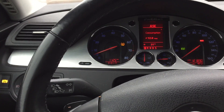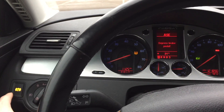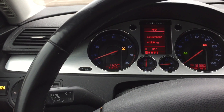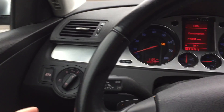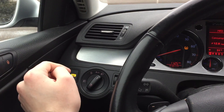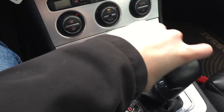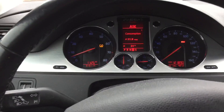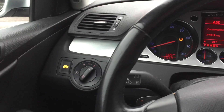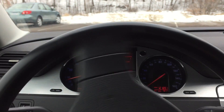The button is to the left of the steering wheel on this Passat — it may be located differently on different vehicles. If you do not press the brake first, when you press to turn off the electronic parking brake, it'll say 'depress brake pedal.' Another method to disengage involves putting your foot on the brake, putting the car into drive, and lightly applying the gas pedal — it'll automatically disengage as you accelerate.